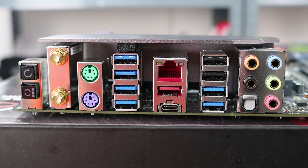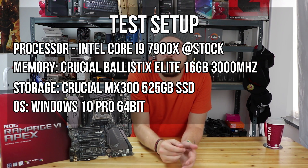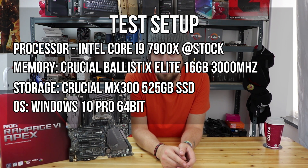Going to the back of the motherboard for the IO — it features a clear CMOS button, a USB BIOS Flashback button, dual 802.11ac Wi-Fi antennas, one PS2 mouse port and one PS2 keyboard port. The separate PS2 ports are especially useful when overclocking, since you don't want to rely on USB during extreme tuning. There's also an RJ45 LAN port, six USB 3.1 ports, two USB 3.1 Gen 2 ports (one Type-A, one Type-C), an S/PDIF optical out, and five 3.5mm audio jacks for surround sound and microphone. That's a quick overview of the motherboard — absolutely gorgeous, with a lot of overclocking-focused features.